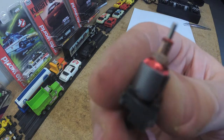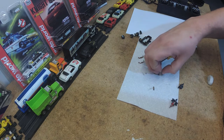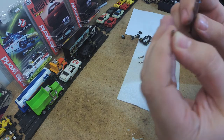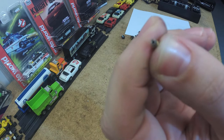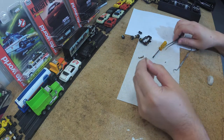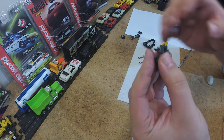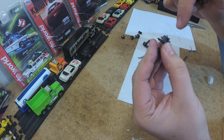That cleaned up really nice with the ink eraser. For the brush, what you do is take it over to a piece of paper and go over it like this and it will get all the residue off. With a little pick tool, I just went in there and pulled the spring up to examine it — it looked fine. You can rub that clean too, then just push it back down and reinsert the brush into the tip. Don't push down on it and let go because it will fly out. Those just push right back in. Whatever you do, don't pull the top off now because the springs will push the brushes closed and you won't be able to get them around the comm again.